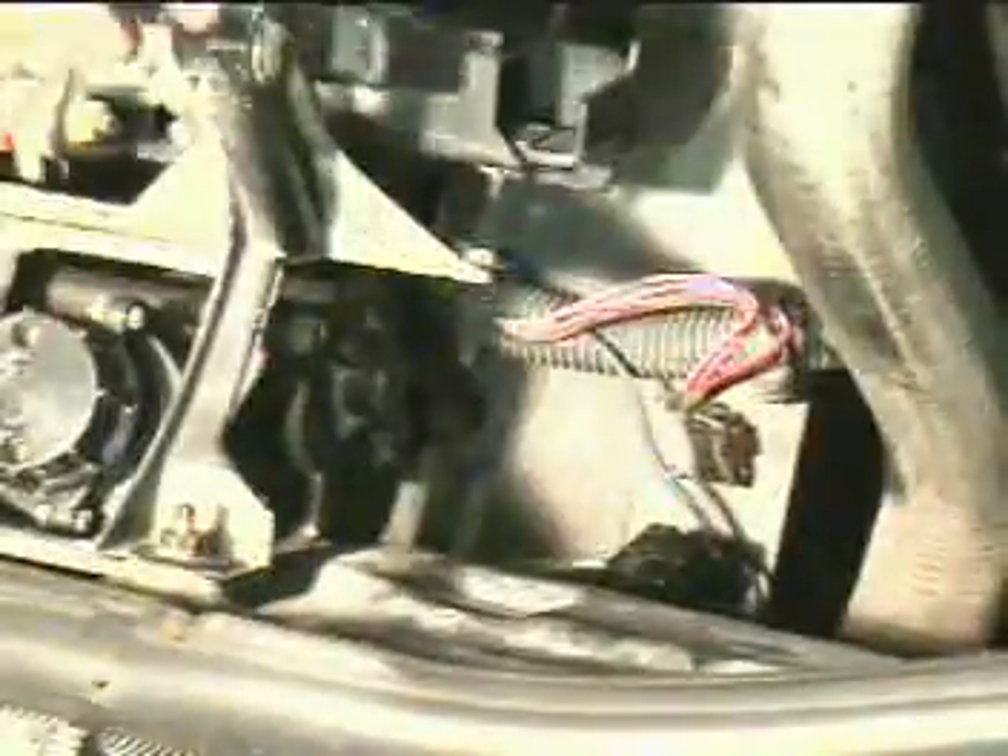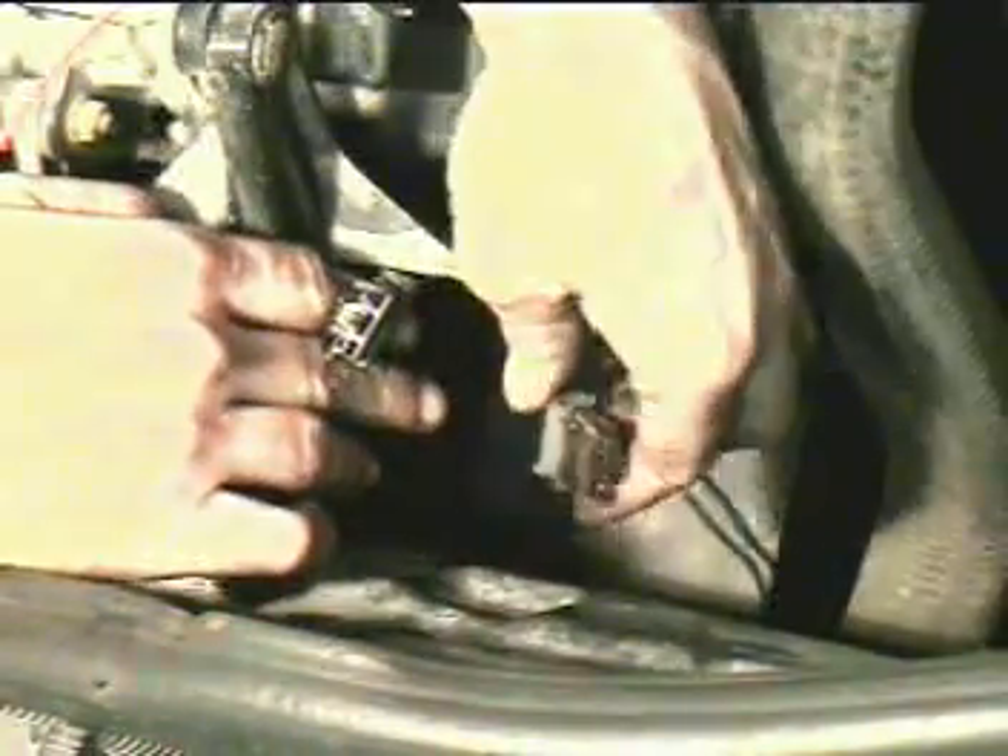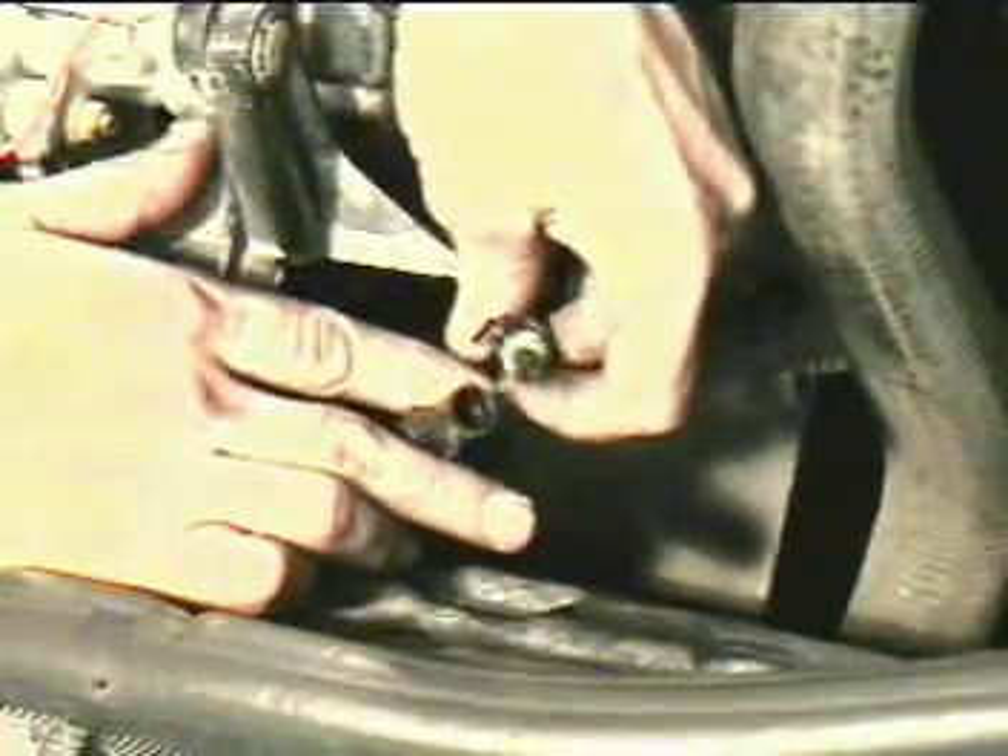So I'm only going to do just one side. The colored wires are the same, the results are the same. Unplug your relay. You've got a three-wire plug and then a two-wire plug. The two-wire plug goes straight to the motor. The three-wire plug is part of the car's wiring harness. And then there is the single blue wire — it's got a plug just like an oxygen sensor connector.